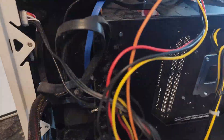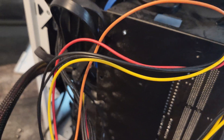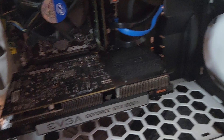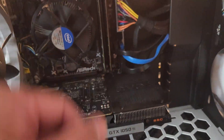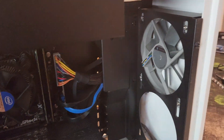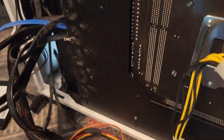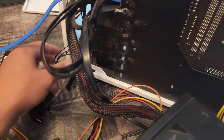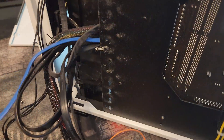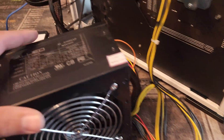We want to follow where this is going — it's going to a fan hub, which honestly this PC doesn't need, and it's just another point of failure. I'd actually probably just take that out. This is literally powering a 1050 Ti and a lower-end CPU. I checked it out — it's an Allied 500-watt, which looks like it can handle everything in here just fine. I'm going to plug the lights back in since I don't think there's a problem with it.